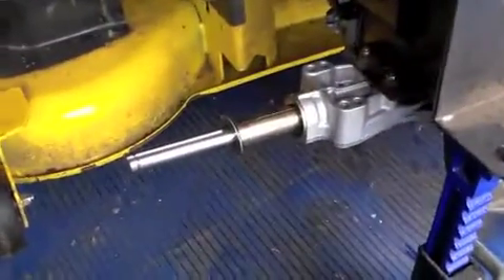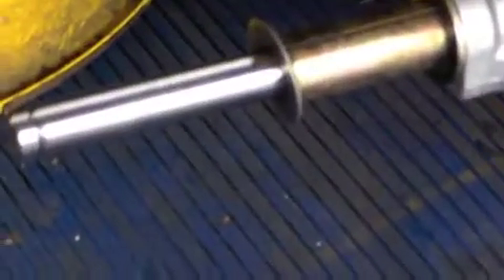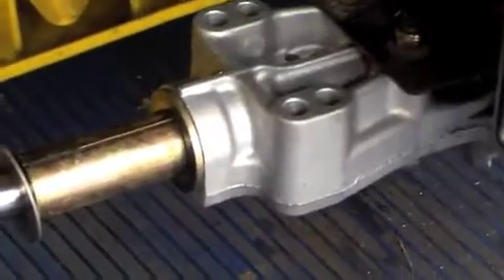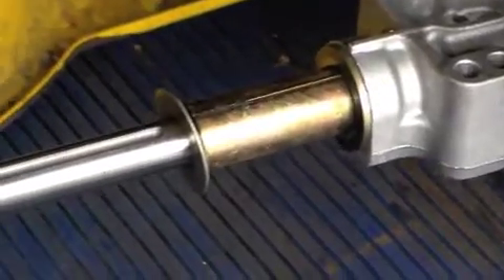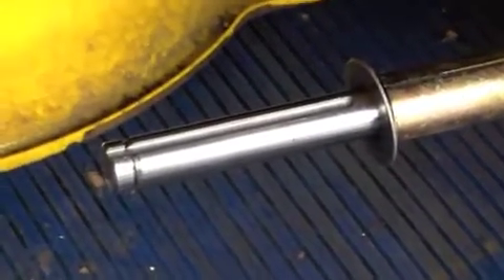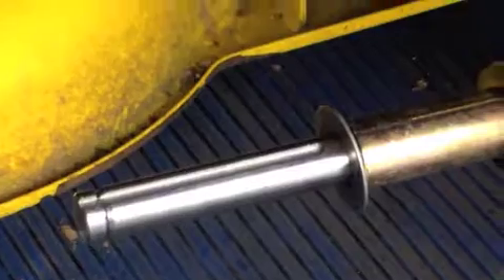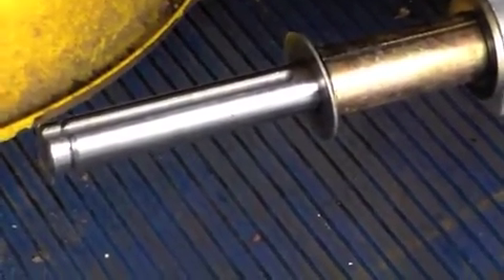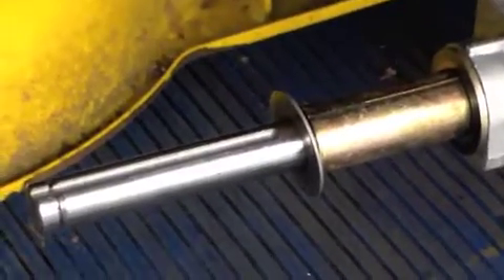I want to show you that key right there. There's a key inside the wheel that you have to grease up. So you got a washer, a spacer, another thrust washer, the key, then the wheel goes on. On the outside of the wheel you got the E-clip and another washer, on the inside of the E-clip.